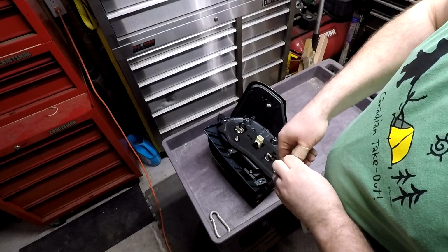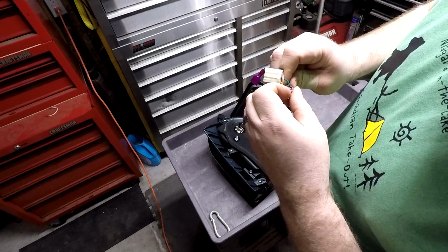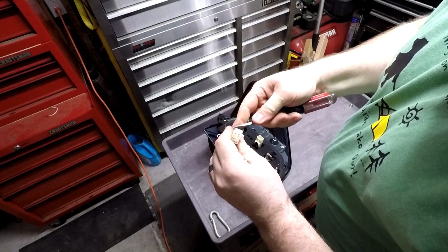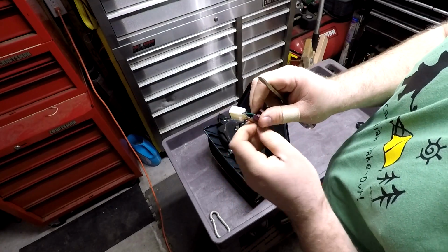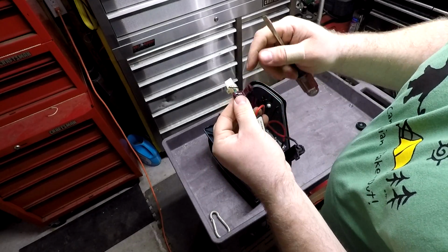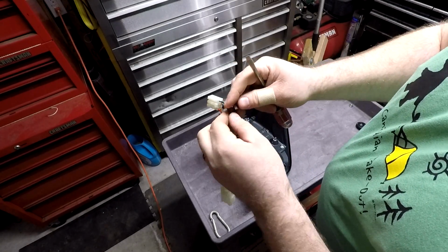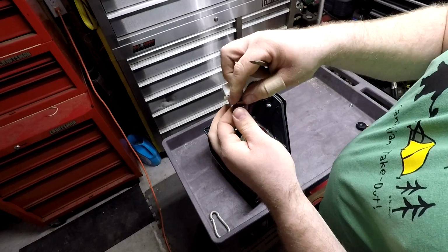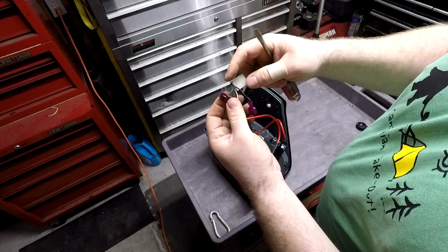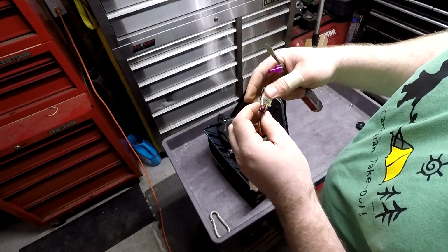If you need help crimping wires on, I did another video with the ditch light install, which walks you through in more detail how to do some of that stuff. But this is just another vampire type clamp. Those other ones were parallel clamps. This is a vampire clamp. So basically what happens is in here you get a piece of metal that will bite on this wire when you crimp this closed. So you put it over the wire, you crimp this closed until it clicks. Now you've got a little piece of metal biting into this wire, so there's barely any exposure of metal from the wire. This is also an internal mod. It's not going to get salty with our New York State salt water in the winter, those types of things.